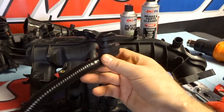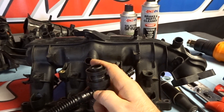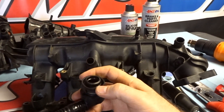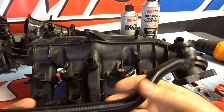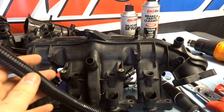Also the other end of the terminal on the turbo side might leak a little bit. What I would recommend doing is just clean it up with some brake clean after you take it off, just to make sure you don't have any issues down the road. These don't really fail all that often so I'm not too concerned about that one. But this line — the actual hose — tends to crack very easily. I like to joke that it's made of peanut brittle because even if you look at it, it tends to crack.